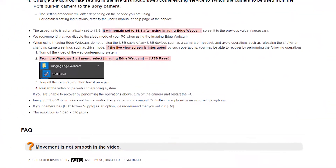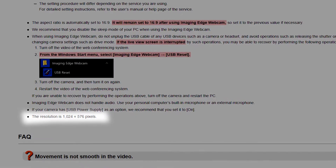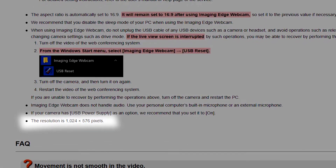The quality is decent, but technically it's not 1080p. According to OBS, and confirmed on the Sony website, it only outputs up to 1024 by 576 resolution — a strange resolution, basically a little under 720p. There was also a random glitch where I opened the source in OBS and when I closed it, it showed the Imaging Edge logo reversed — not really sure what that was about.